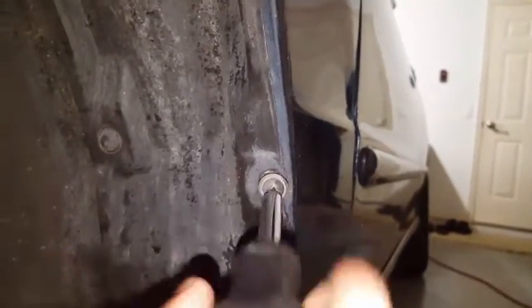Now that we have the car jacked up in the air — remember, use jack stands — and we have the wheel off, I just want to show you guys something. This is the fender liner that goes underneath the fender and protects all the dirt and grime from underneath the road entering the engine bay or your fender which goes into your door. Most of the time when you do roll fenders, the tabs which connect the fender liner to the actual fender themselves get pushed in, so you won't be able to retain it, although there are ways using zip ties and other methods. In our case we are going to take it off first by removing these Phillips head screws and these clips right here. These are basically just pop-outs — there is a special tool but you can also use a flat head to pry it and then pull off the whole assembly.